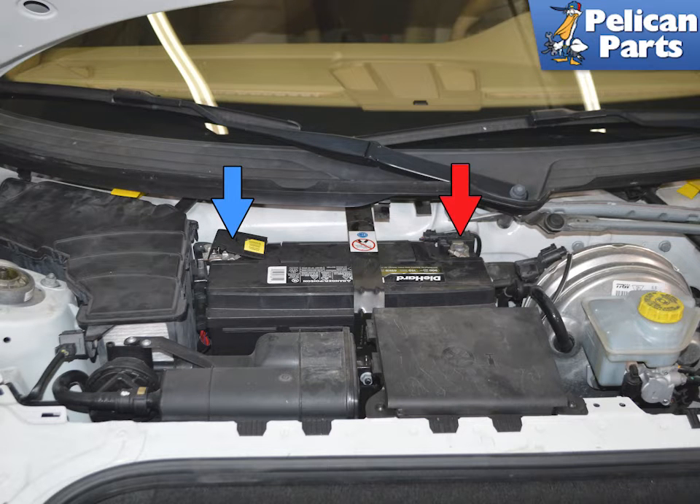You are going to be removing the steering wheel airbag to access the steering sensor or clock spring. Before you begin, disconnect the negative terminal (red arrow) and then the positive cable (blue arrow) from the battery with a 10 millimeter socket, and then wait at least 20 minutes for the residual energy in the system to dissipate. If you have an electronic adjuster for your steering column, make sure to lower it as far as it will go before disconnecting the battery.